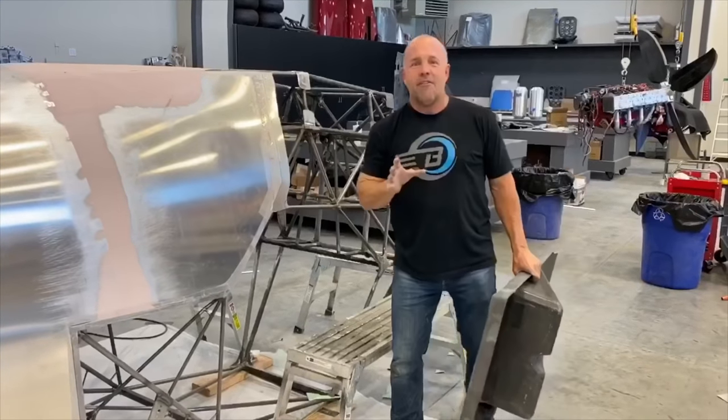The carbon fiber is ready to come off. I did things like wrapping the carbon all the way around knowing I couldn't pull the part off until I trim it. So right now I'm making my split line here on the top. This entire part is going to clamshell open like this and come off as one giant part. If I ever needed to do service, I can actually remove this whole thing, weld the cage, put it back on, do whatever I need to do. What I'm doing here: I've marked where I'm going to split it - I overran the carbon fiber here really thin so it's easy. I put clear tape down on the carbon fiber and slide this aluminum underneath, then trim down until I hit the aluminum and won't hurt it. Work my way across and I'll trim the whole airplane that way.